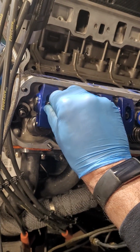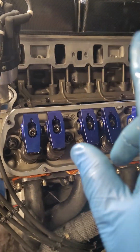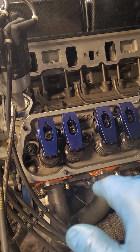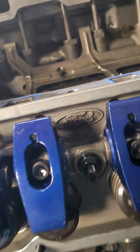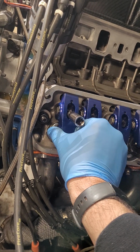Didn't find anything weird over there either, guys, on that side. I went through all those valves, loosened them up, rechecked them and everything was fine. Nothing out of the norm. Again, I'm going to leak down cylinder 1. I'm just curious if the head gasket's nipped or not. I don't know, just trying to cover all my bases while I'm here.